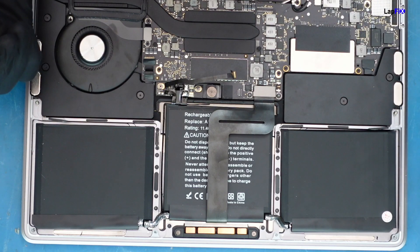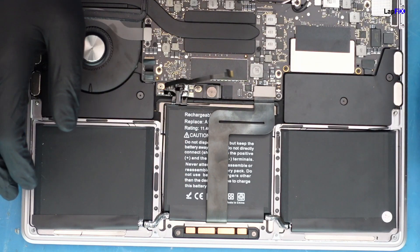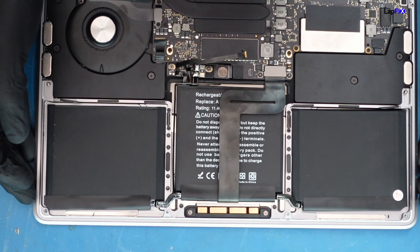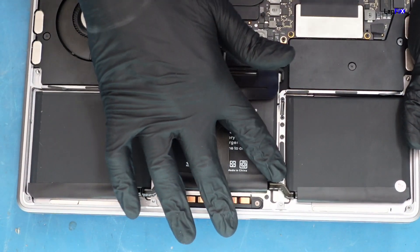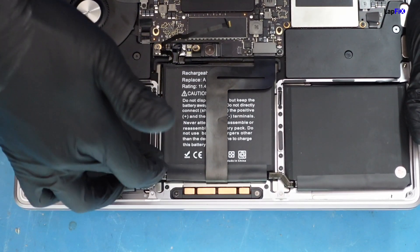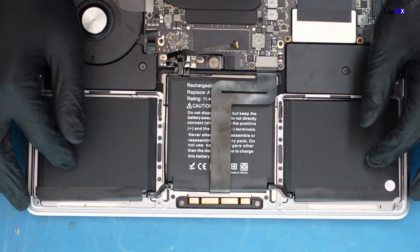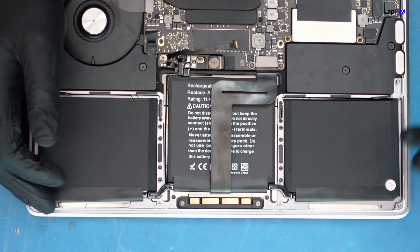We're more concerned about a connection problem — most likely there's a problem with the trackpad cable. You can see there's even a little bit of a bend and lots of marks around it, and this cable is loose. We want to check charging after we get the trackpad working. There are screws here that are part of the trackpad — the trackpad goes underneath and there are about ten screws on the bottom. The problem with these models is that the batteries are adhered to the frame — there are no screws, no easy way to pull it off.